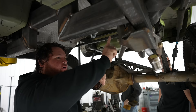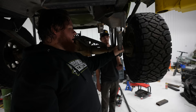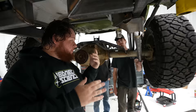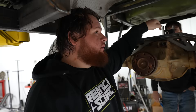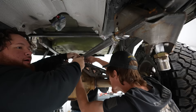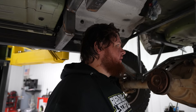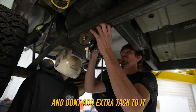After a lot of staring at it, I think we figured this out. We've got these four-link brackets — we're going to do upper link bars to the top of the axle truss, and then a bottom bar going right down there to hold the axle from sliding forward. That way we don't need a panhard bar or track bar, because it's triangulated on top and has plenty of articulation. All we have to do is cut a couple bars, tack weld them, take the bars out, and see if the axle moves the right way. Look at that — the new bar is in. Hell yeah! That is sweet. 25% of the work is done.